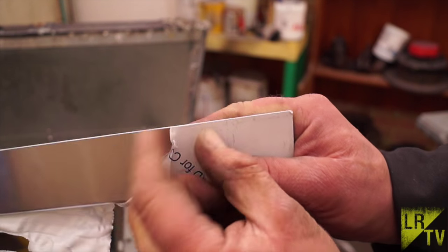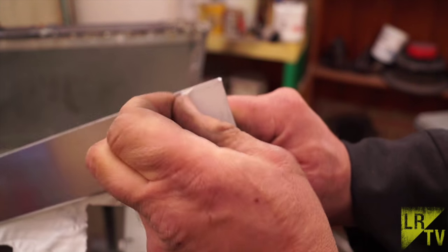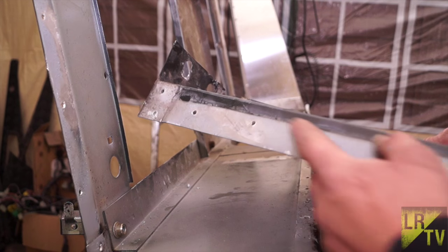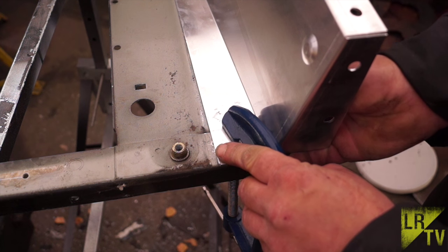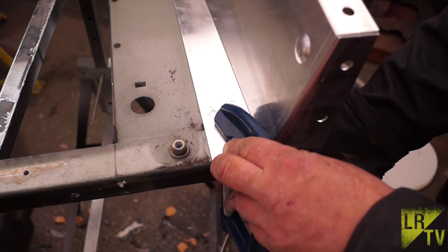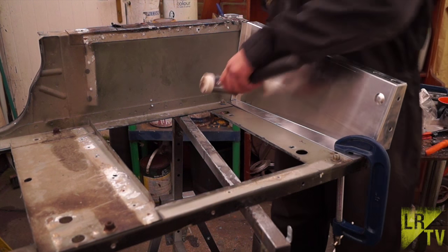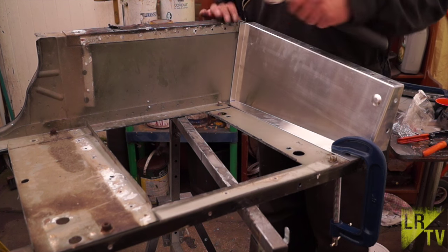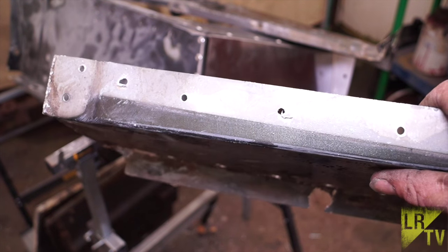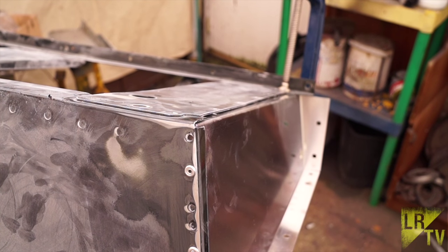The plastic covering on the aluminium can basically be picked off. If it's slightly warmer it will come off easier. You don't really want to leave this on — there's no need to use it as an anti-corrosion protector because aluminium with aluminium will not corrode to any great extent. The great thing about this panel is it is accurate, so matching it up to where the other panel sat before is quite easy. I'd advise clamping it down gently with a jig clamp on either end, making sure it's squared up before you go ahead and drill holes. You could measure between this point and this point to get it perfectly accurate before you fit it, then drill a couple of holes and fit the rivets in to either side.